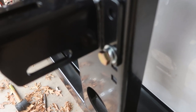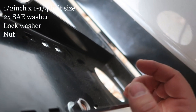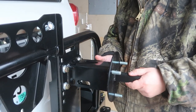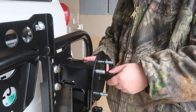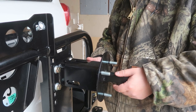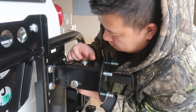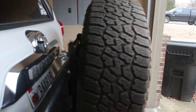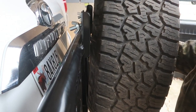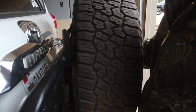Just to show you guys what I'm doing here: lock nut, washer, put the bolt in, and then behind here a washer and a nut. You can position the tire as close or as far out as you want — I'm just going to put it as close as possible. I'm measuring the gap here to determine how far to leave it, and I think I'll use this gap right here and tighten it up.